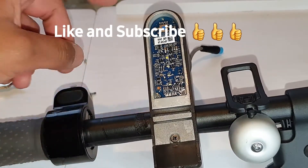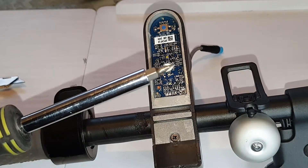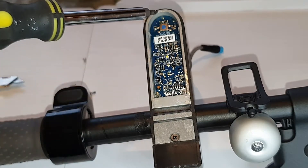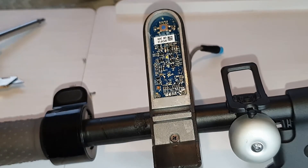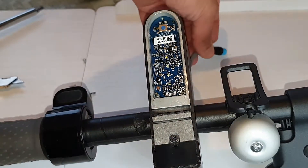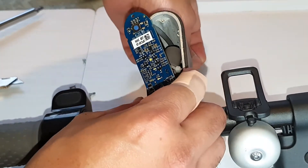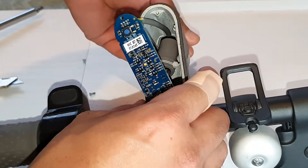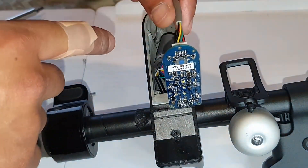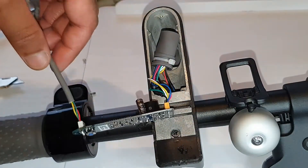The next step is to remove the three screws - you need a small Phillips head to do it. There's one down here, one on the right here, and one right at the top. Once you've removed all three screws, you just need to pull on this back wire and push up - you can see the actual motherboard itself just comes right out. You want to take this blue wire all the way through and make sure you don't pull on these loose wires; grab onto the shrink wrap.